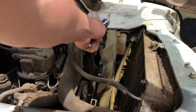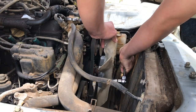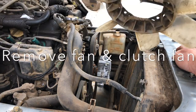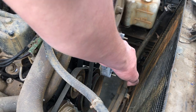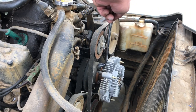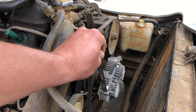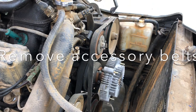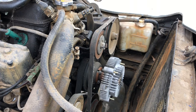Take a deep socket 10 mil — I think it'll get this clutch off, if not it'll at least get the fan off and give us a little bit more space. I think this tensioner is actually kind of in the way. I want to remove the clutch fan, but I don't want to struggle. So I'm gonna undo the tensioner, get the accessory belt off, possibly order another one, and then move this out of the way and hopefully get some more space.